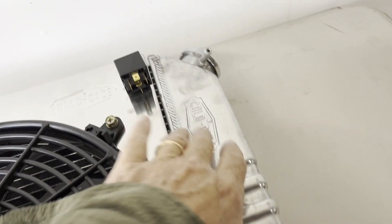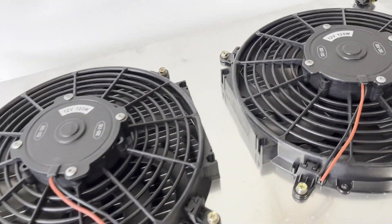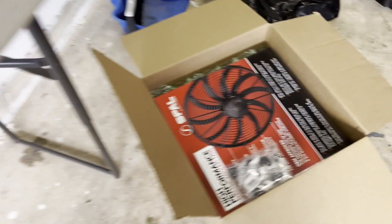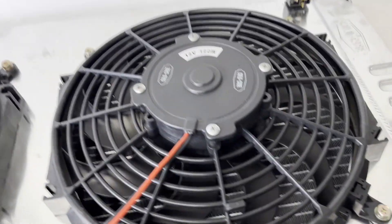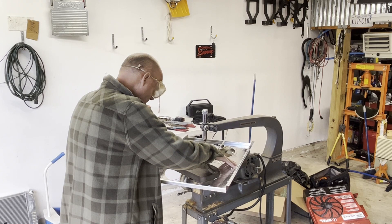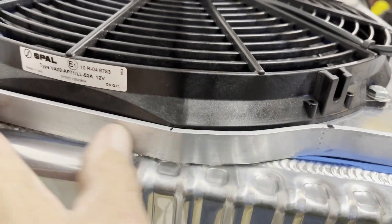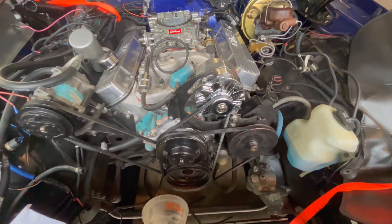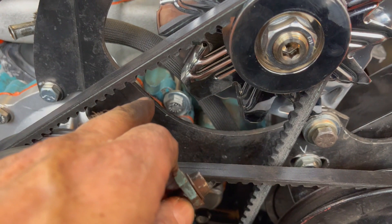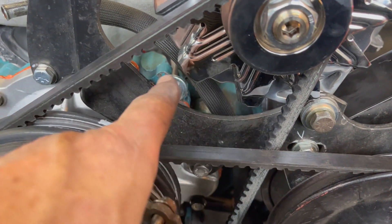This is the Cold Case radiator that I had installed in the Trans Am — it really wasn't doing a great job of cooling. I watched Fast Monty's channel and he recommends these high-performance cooling fans, 14 inches. I'm going to try to open up this fan shroud. This gap here is a little bit too big — just close it up with that. Air con, power steering, and alternator are installed. I've upgraded the alternator for the bigger fans. Naturally, only after I installed the alternator bracket did I find the special washer I was missing.